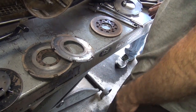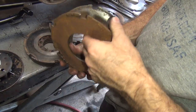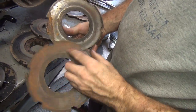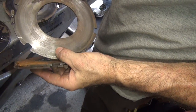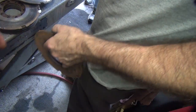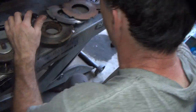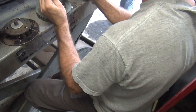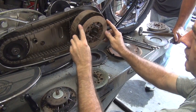Here's some nice cherry ones I dug out of my valuable used clutch pile. We're going to pick two of these out of this pile. This one's starting to gouge up a little bit. So the ones that are all good — this one looks like this... What's wrong with that? Well, it's supposed to be like this. This is really grabby on your plates. Look at that — it's all roasted. There's nothing wrong with that one. Rust will go away, Dan — as soon as you use it. Just like the clutch basket in here is rusty too.